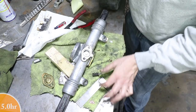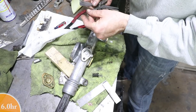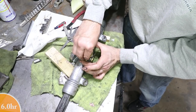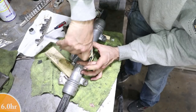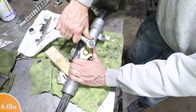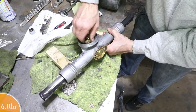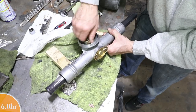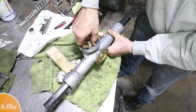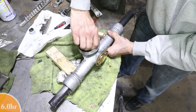That's 5/1000ths. Yeah, that's a pretty tight 8. It's probably 7. So now there's noticeably more pressure on the shaft. But I think that's a good thing. I can feel the pinion making contact with the rack teeth, but it's a smooth motion.